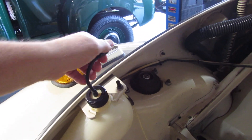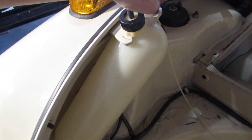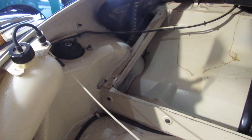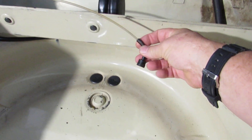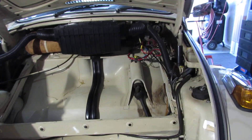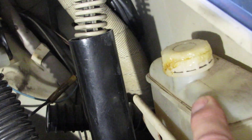What you do is fill the washer bottle up with air — 35 to 45 pounds — there's actually a Schrader valve right there that pressurizes the bottle. To maintain pressurization after using the windshield washer, there's a line here that I couldn't figure out where it went. I looked at the end of it and it's the same size as a tire valve — you'd just screw that into the top of the spare tire to supply backup air. Also, the reservoir cap was cracked and repaired with some kind of glue, and the reservoir itself has a crack in it, so I'm going to have to replace that.